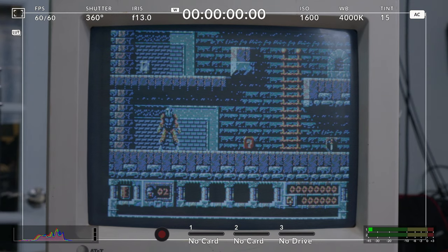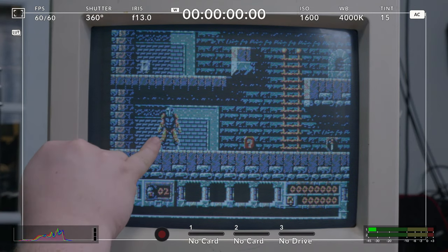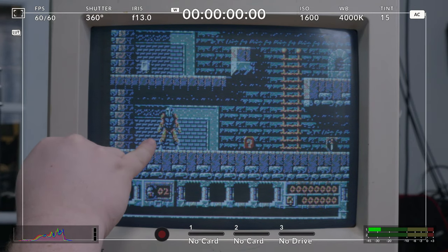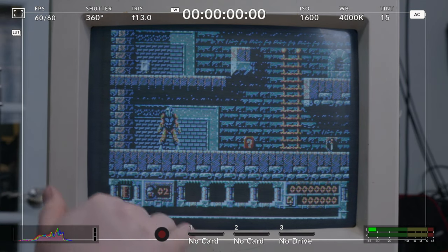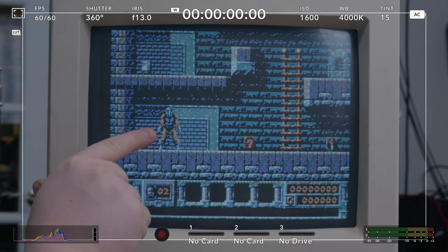So we're changing how we're interpreting the image, but it's the exact same image. Then when we get to the end here, this is 6-bit color. That's how it's supposed to look. If we compare here, this guy has deep shadows on the back of his leg, and he's got an unpleasant kind of green there, although that's supposed to be brown, because this isn't implementing the IBM brown adjustment. And then you've got this bright, almost salmon color here.